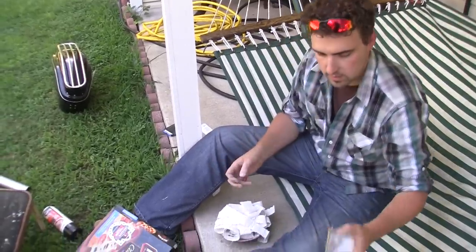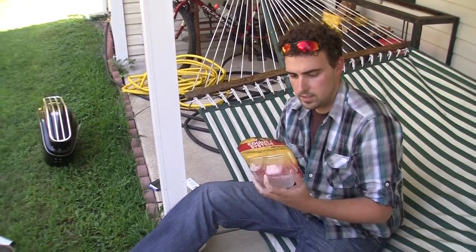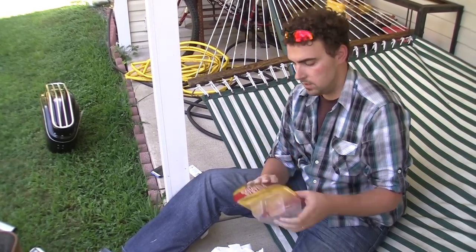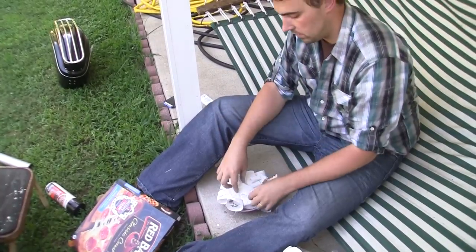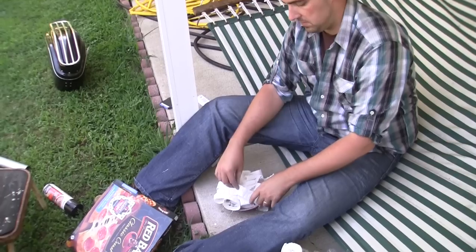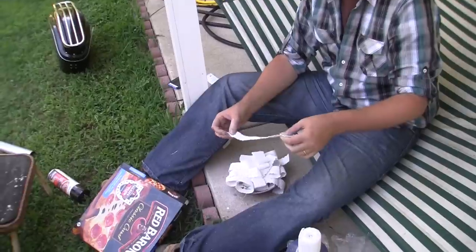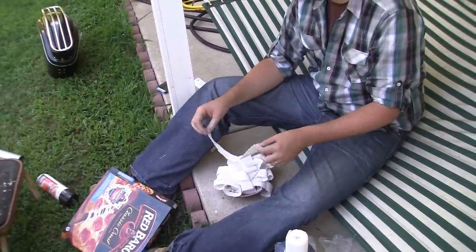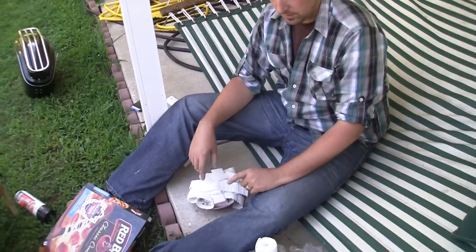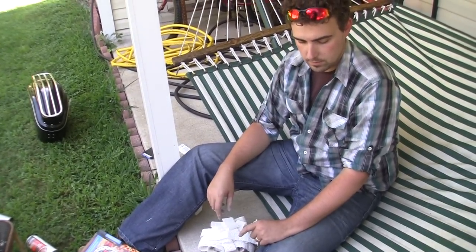So in the kit that you're going to get — it's an exhaust system repair kit. Basically what they say is cut bandage into twelve-inch pieces for exhaust or tailpipe, or two-foot pieces for muffler. We're dealing with a really small thing and trying to pack it in there. It comes in these wide bandages, and you're going to cut them into approximately ten- to twelve-inch pieces. But I cut them in half — that way you get more flexibility in actually stuffing them in there. My tailpipe should be dry in terms of paint, and we're going to start pulling.